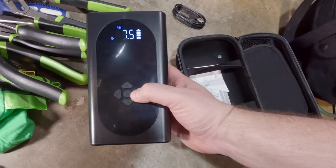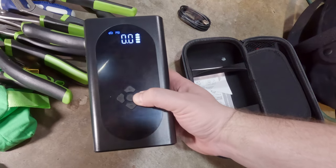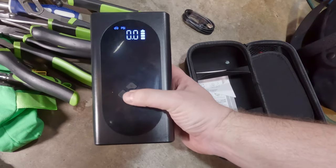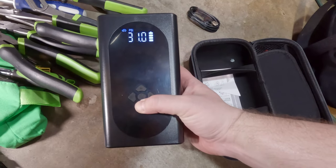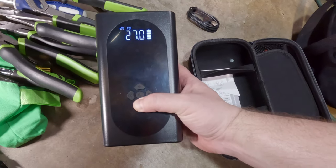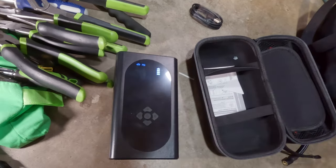This little R button looks like it changes the mode. You hold down the R button and it changes the units you work in, so I'll leave it in PSI. The car mode shows 35, but we don't need 35 for the 4C — the fronts are 26 and the rears are 29. I might give it just a little bit more just in case.